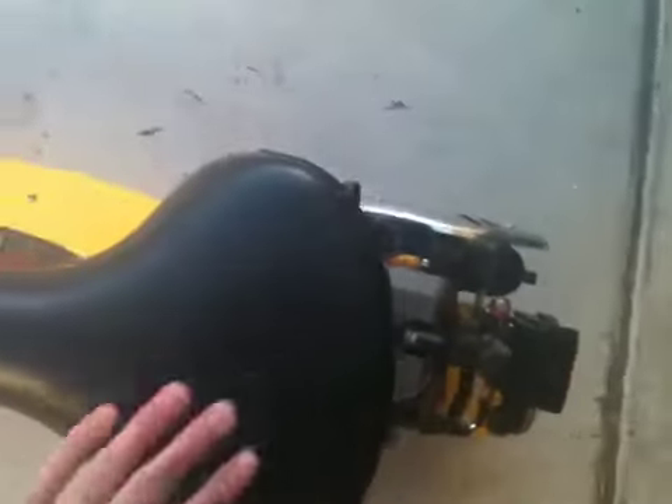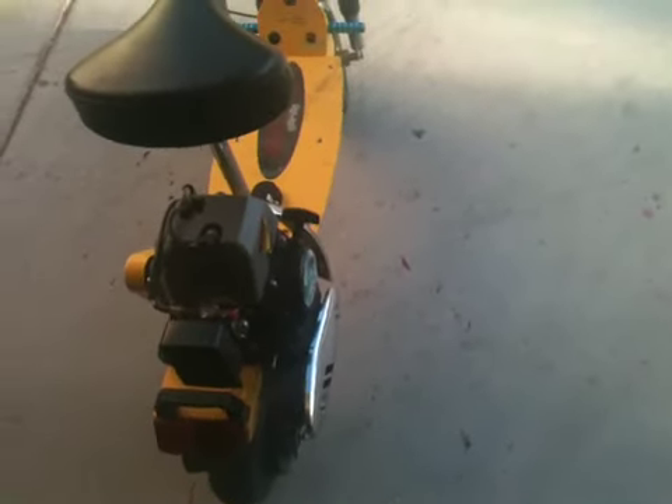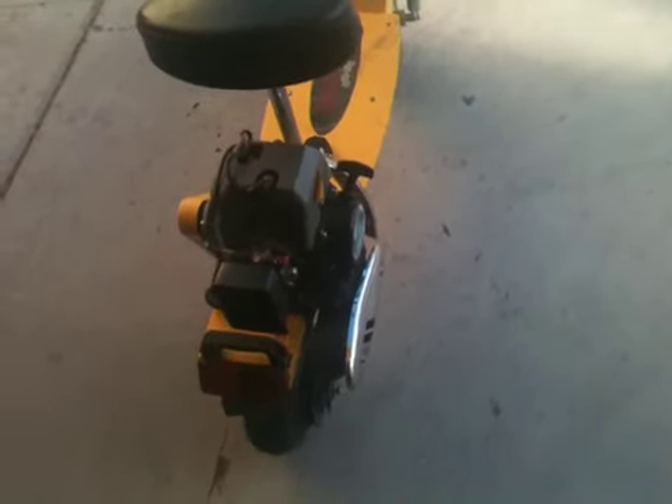The seat's in really good condition, it's like brand new practically. I'm going to power wash it, degrease it, do a carburetor clean, check the gasket on the carburetor, and get an air filter for it. It runs awesome, there's no problem with the idling or running, although at full throttle it doesn't want to stay at a steady RPM. That might be because there's no air filter and it's not the right back pressure for the carburetor, but otherwise it's really good.